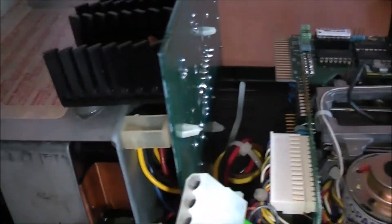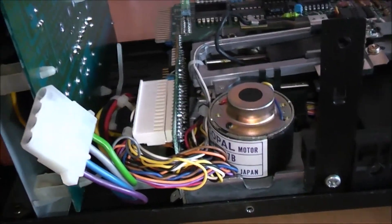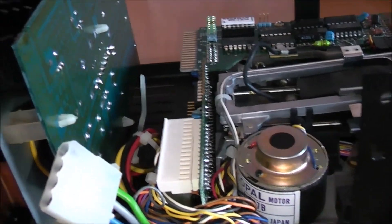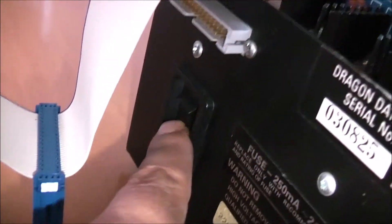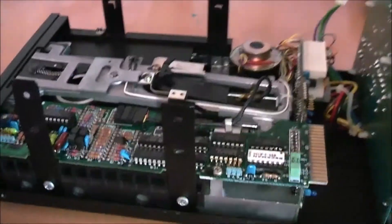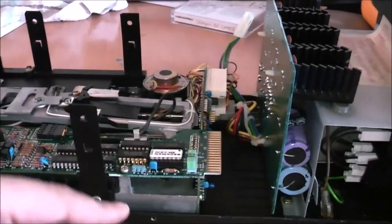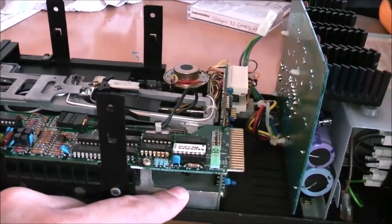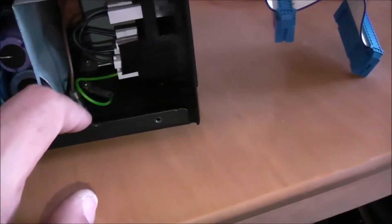The fuse keeps popping in this, so I don't know how I'm going to test how far the voltages are going, because as soon as I put a fuse in it's going to pop it straight away. So all I can do is maybe test the switch — make sure there's no shorts around this on-off switch at the back, although it feels pretty solid with no internal breakage. When I got this thing to work I had actually lifted the whole internal part out and set it on its side, testing the voltage going to the stepper motor, and all of a sudden it started working and then just died.